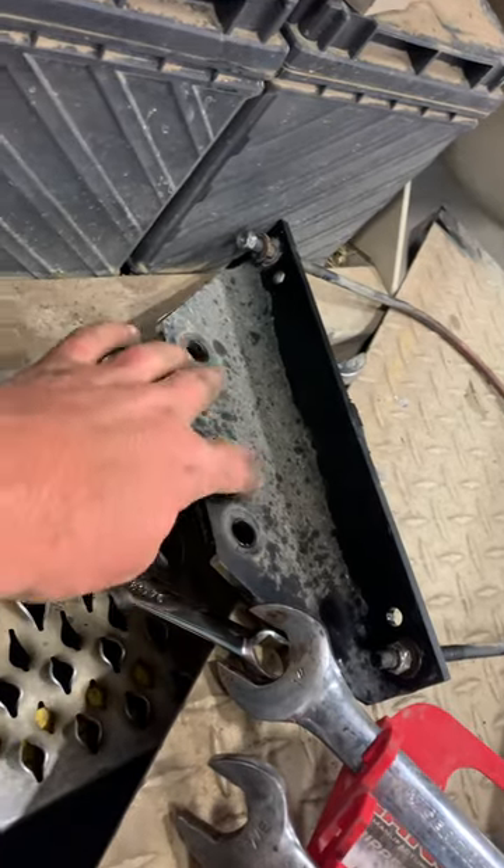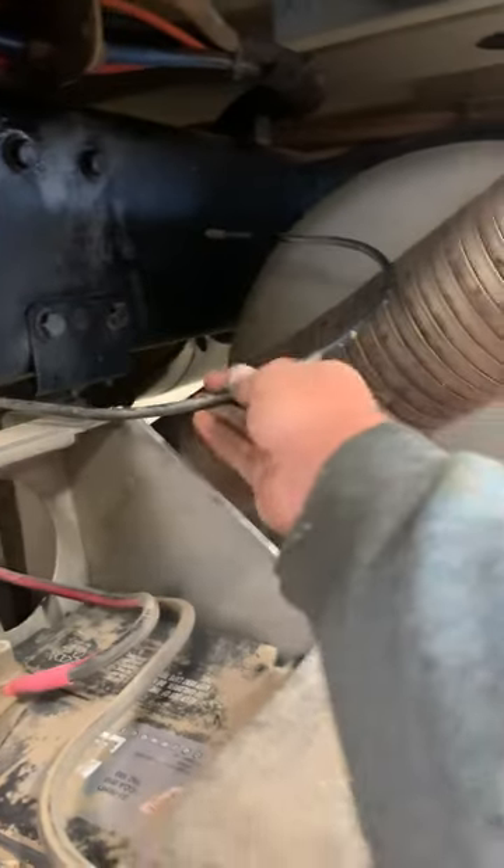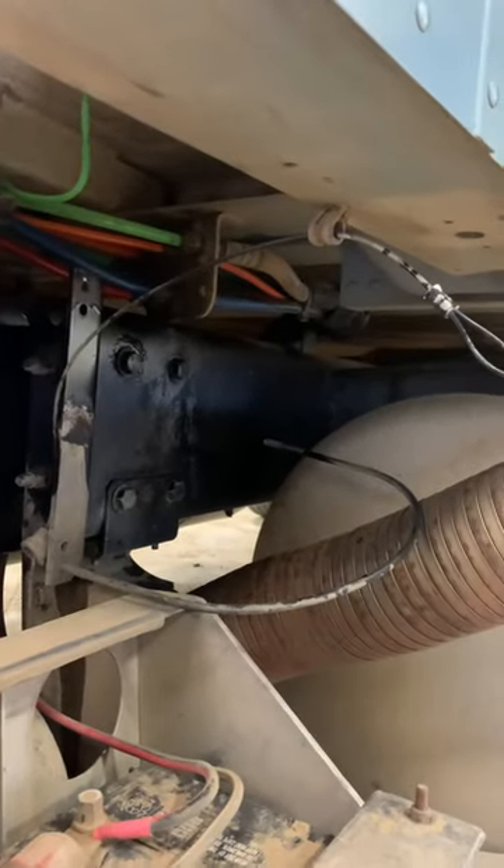I couldn't get to that, so I just took off the three-quarter inch bolts — two of them on the side. That is the bracket that holds your U-bolt to it. On this side I was able to get it; I had a long extension right into the back and was able to sneak the impact on and take it off. Otherwise you've got to get a ratchet wrench, half inch, and just slowly work them off.